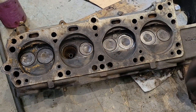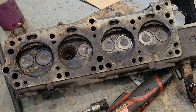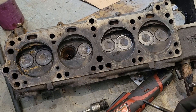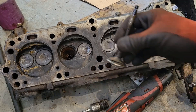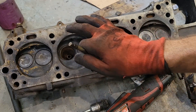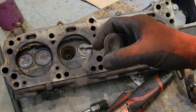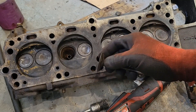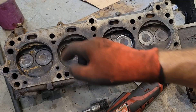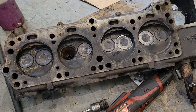Right here is your valve seat. If you've ever heard someone say you need hardened valve seats for unleaded gas — a lot of older cars from the '50s and '60s — someone might say don't run modern gas, you need a lead additive so you don't ruin the valve seats. Some vehicles started incorporating hardened valve seats in the '60s and '70s; by 1972 when the government mandated EPA regulations, gasoline makers were essentially phasing out leaded gasoline. The seat on a lot of cylinder heads is removable and you can have your machine shop put hardened seats in so you can run modern gasoline in an old engine.